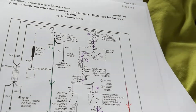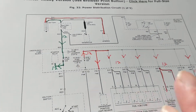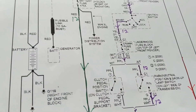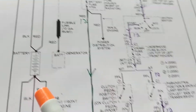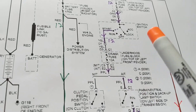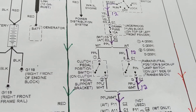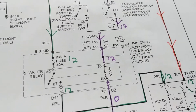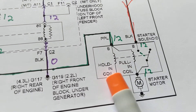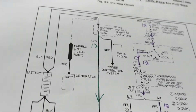Continuing the tutorials about the starter motor. If you go to the block diagram it's a little easier, but they leave some things out. At the component level it's a little more clear. I always start from finding this part - the starter motor itself. Then I go back. We know the ignition key is involved. In this case there is no computer involved, so it's going to be ignition key, a relay, and a starter. There are also two solenoids - a hold-in and a pull-in - which most have nowadays.